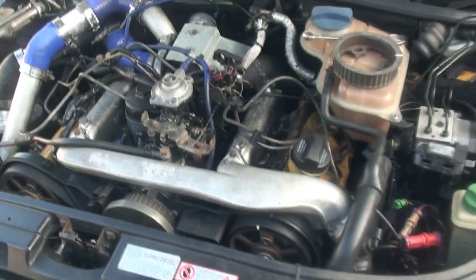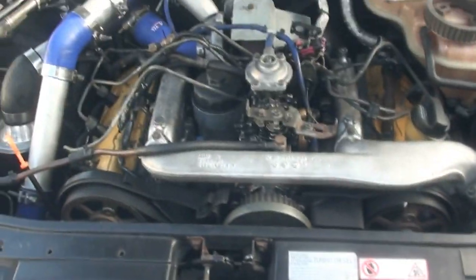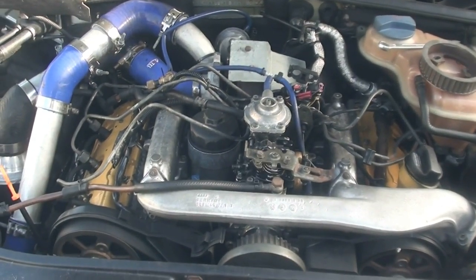I have managed to find one 6-cylinder head, but the issue is it's a 10mm head. And I wouldn't generally recommend anything less than 11mm for anything DI, let alone trying to make power. But hopefully with enough duration, it'll build enough pressure to crack the injectors. It'll run, it'll make bugger all power, but it'll run and it'll keep moving.